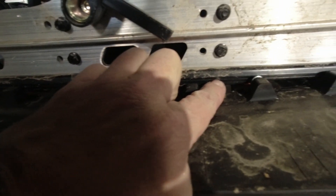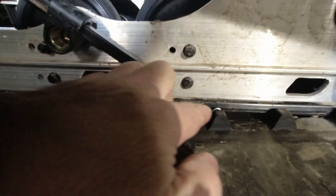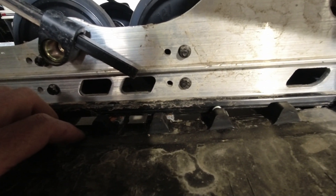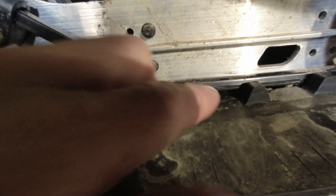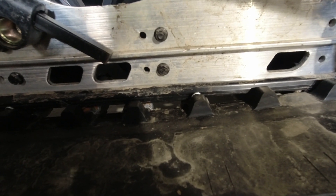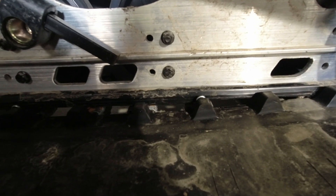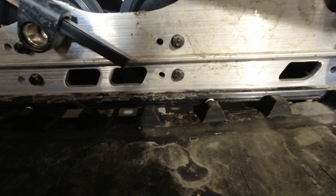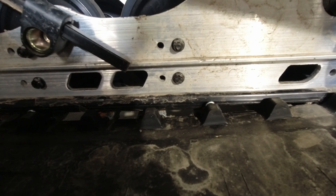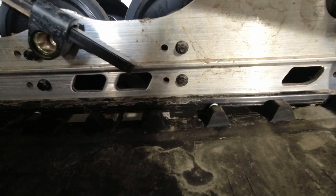Under here we've got the slider and there's kind of a groove - a wear bar. When you get down to that it's time to change your slides, and you can see we're getting pretty close to the wear bar here. Last year was hard on slides, and this machine is five years old. Slides are $40 a piece at the local dealership - genuine BRP parts - and it's a good opportunity to pull the slide cage out, give it a going over, make sure all the bearings are good and grease everything up. Get it ready for five more years of use.